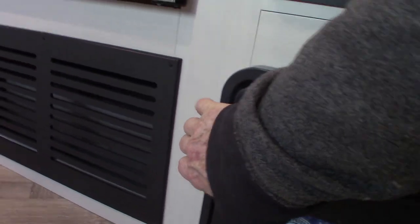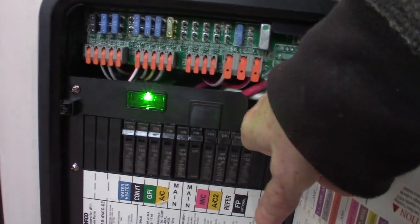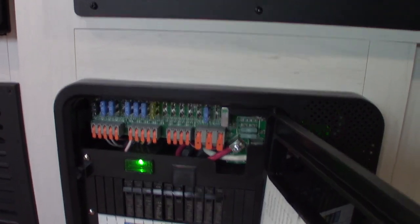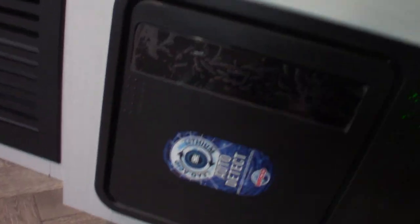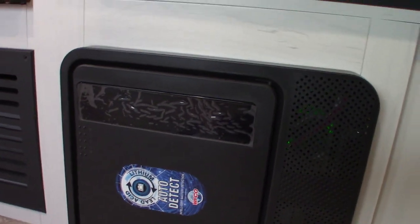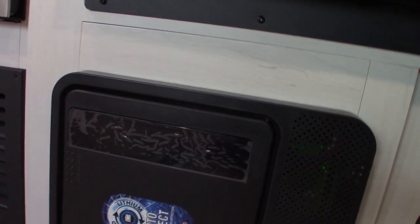This is your power converter right here. It converts AC to DC power. You have regular 110 AC circuit breakers — they're all labeled — and 12-volt fuses up here, also labeled. When you're plugged in, it takes your AC power and converts it to 12-volt DC. It's also a battery tender, so it senses how much energy your battery up front needs and keeps it charged. It has intelligent battery detection and can tell what kind of batteries you have automatically. So it's a battery charger/tender and converts 110 AC to 12-volt DC.